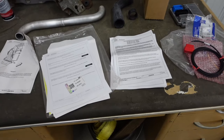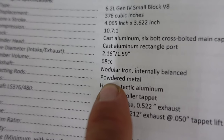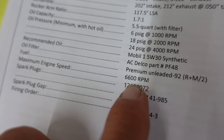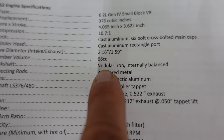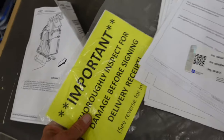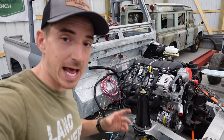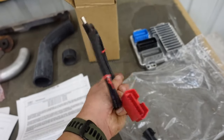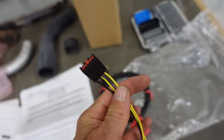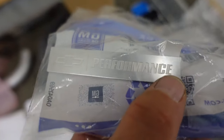Alright, now that we're done being a child, let's take a peek at this paperwork that came with the engine itself. We've got our specs: 376 cubic inches, connecting rods are powdered metal — that doesn't sound all that great — redline is 6,600 RPMs, we need 92 octane, which is kind of hard since we mainly only have 91 around here. It's actually cool to get that spec sheet — nodular iron — and it gives you the break-in procedure. We got a bag of silicone lubricant. These bits here look like they're for some tuning — plugs into the OBD2 port, USB on the other side. And this is pretty sweet: an aluminum badge that says Chevrolet Performance. We've also got a flash drive — this must include all the nuclear launch codes.